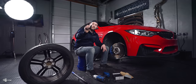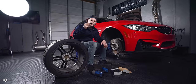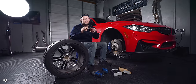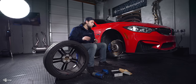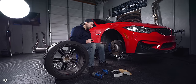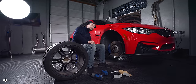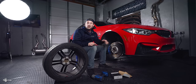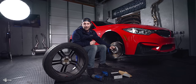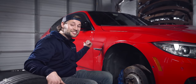As you'll notice, the kit comes with cold forged steel lug nuts. What I really like about them: first, they're extended and have a little grip, making them super easy to get on. Second, they are open-ended — meaning if you want to run a spacer, I have the length here for a 15 millimeter spacer. Or if you want to run new wheels, the bolt will just go right through the nut, so they're universal no matter what size wheel you have.